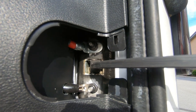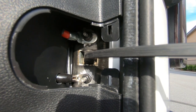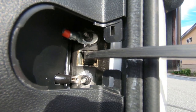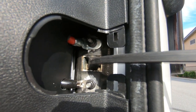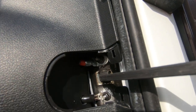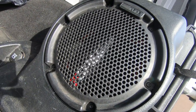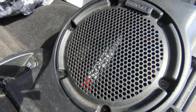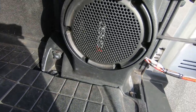I put a little piece of split loom here because it's dragging on this just a tiny bit. This is where I chose to ground my amp and my capacitor. After I had the sub box off, I went in and unscrewed the nuts, ground the back side of the paint off the nuts and also underneath. Then I removed four screws around that whole plate and ground the paint off on the tub and also on the back side of the bracket so we've got a really good ground. I should probably still put a little clear coat on there to keep it from corroding. So this is the ground for the capacitor, this is the ground for the subwoofer, and inside the factory sub enclosure is the 1.5 farad capacitor. Everything turned out pretty nice — you really can't tell how much is in there. It's pretty clean, just like I did with the factory sub. I didn't have to scab up any plastic.